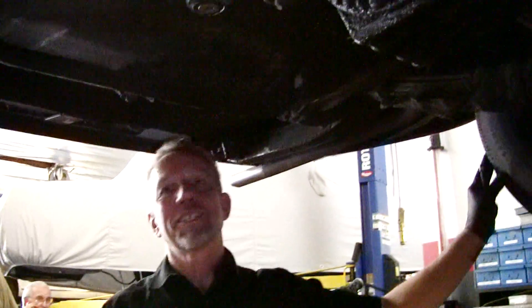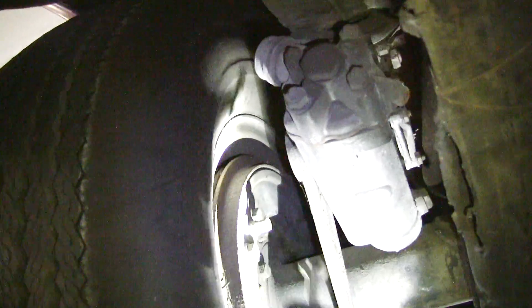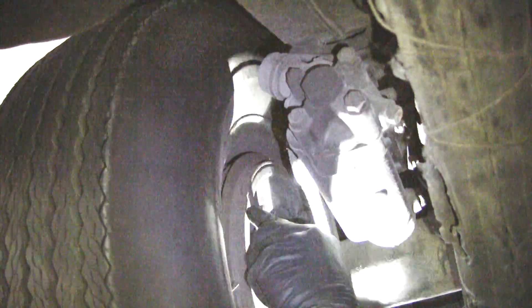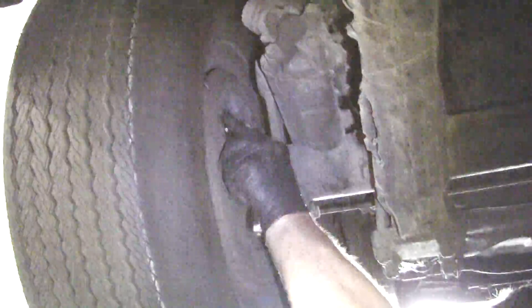Okay, here's how Ronnie adjusts the brakes. Disconnect this rod, disconnect your springs. We just looked at those expanders, made sure they weren't frozen, the linings look good. The adjuster is right up here. You can tell if you get to one of these adjusters and you see just a little bit sticking out — you probably have worn out shoes and worn out drums. This one is out a long way, that means it's not adjusted. So what I do is keep tightening it while turning the wheel. Tightening means you're expanding those shoes and pushing them back to these mechanical expanders.